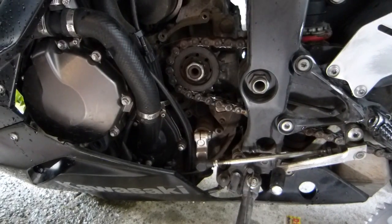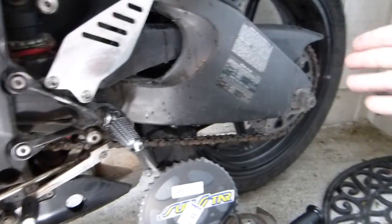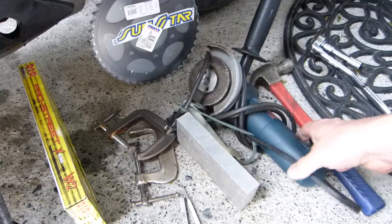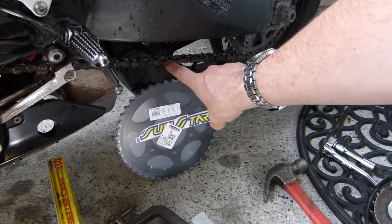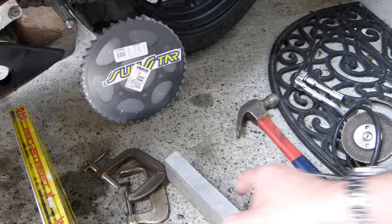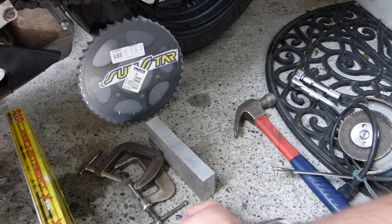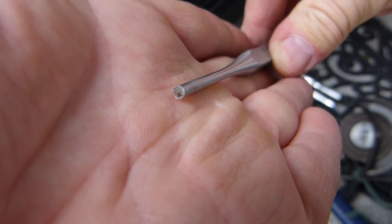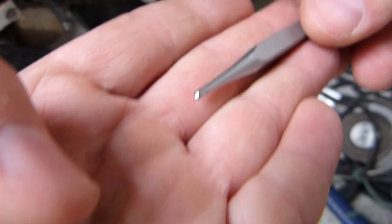You're going to need a cold chisel. For the rear wheel, you're going to need a grinder to grind off two pin heads on the chain — very straightforward, just the pin heads, one on each side of the same link. You're going to need two clamps and a block of steel or aluminum as your workbench. You'll need a pin driver — flat end — to drive out the pins from the chain, and a center punch to help form the rivet head for the new chain.